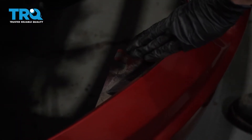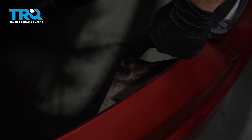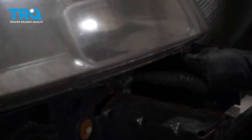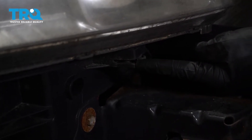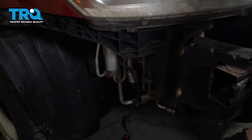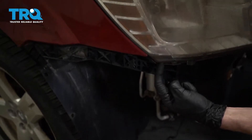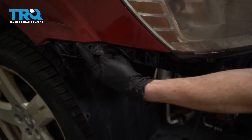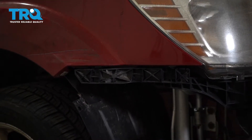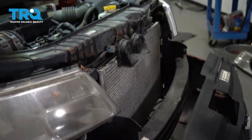Now we're at the point where we're ready to start putting the bumper cover on. The areas we want to pay attention to are along this area here — that needs to fit up inside directly underneath your headlamp assembly, and you're going to have that on both sides of the vehicle. We're also going to pay attention to these areas along here — that needs to slide up and into this groove, and that's how it gets held on. As we start putting this up, we'll put in a couple push pins to hold it in the center and then start lining up each of the corners.